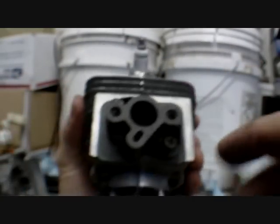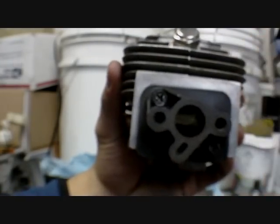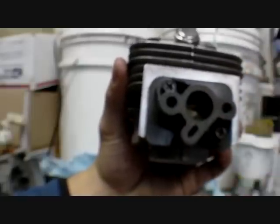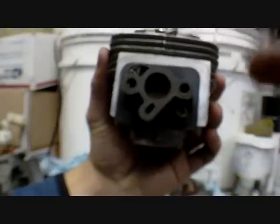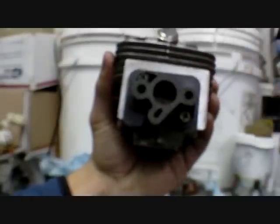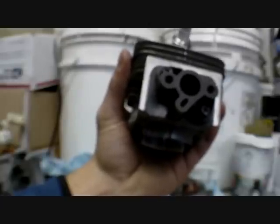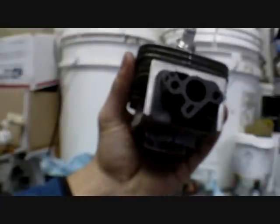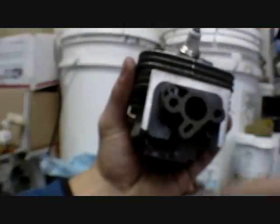But on most bikes, especially if they're reed implemented bikes, fuel and air will mix together. When fuel and air mix together, you want it to be a rough surface. Why? Because a rough surface will allow the fuel and air to slide over the surface faster. If it's super shiny and slick like glass, it's going to form droplets. Droplets create drag. It's almost like physics, where you just reduce the surface tension. So if you want faster flowing fuel and air, you want to make sure that the surface is rough.